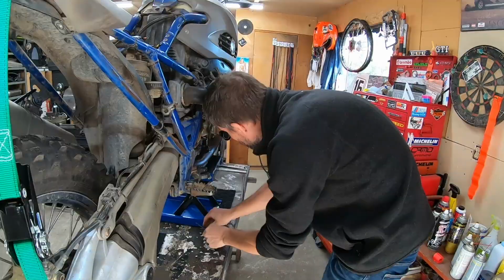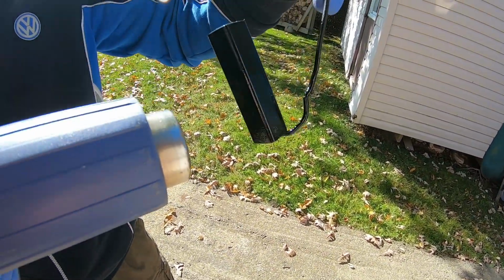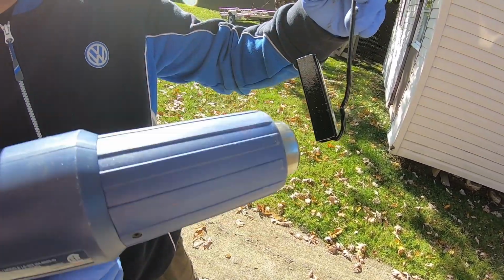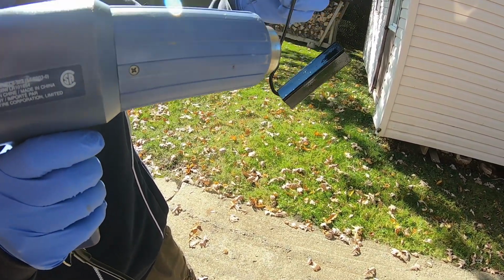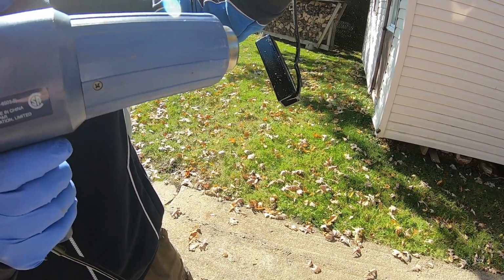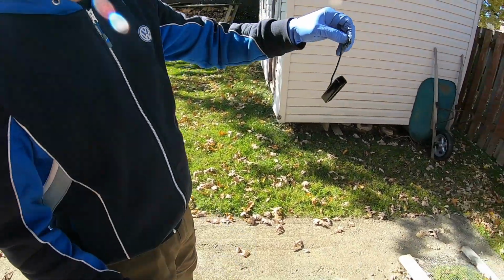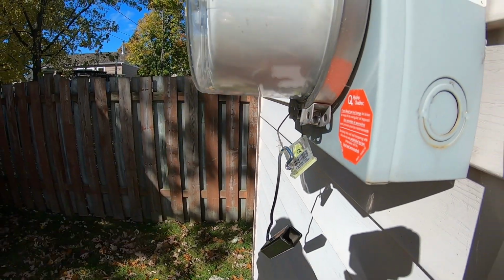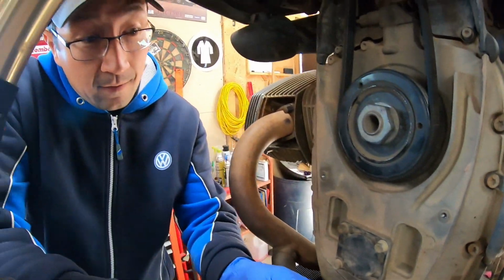Better? Better. This is a step where I burn the paint off with the heat gun, and we start over again. Isn't this what this is meant for? Paint stripping? Paint drying. Just get it hot so that it dries faster, but don't blister it. That's good. We re-tap the 3 holes.